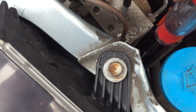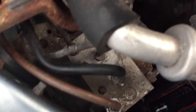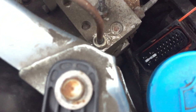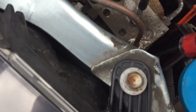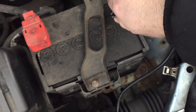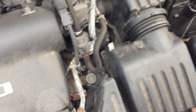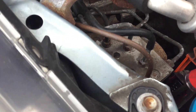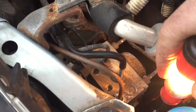That's a power pin there, and another power pin there. The two on the left are the two powers and the two on the right are the two grounds. Check the ground connections with the test light — you can see it's lighting up there. There's another ground there — so that's all good.